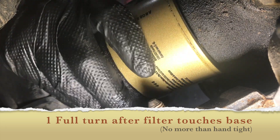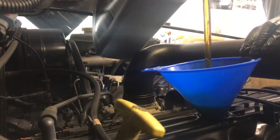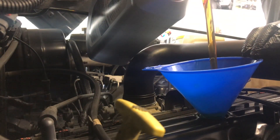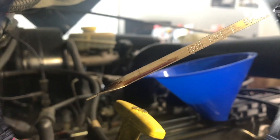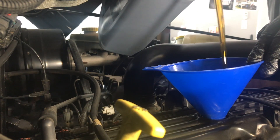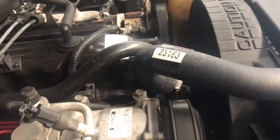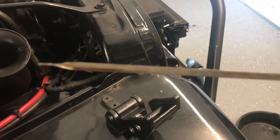Now you're ready to put your oil in — make sure you use your large mouth funnel and do not spill it. This is where you access the engine oil dipstick; it will say either add or safe. Do not overfill it. It is still below the add line, so we need to add another quart. This one takes six. You want to run the engine before checking it again to make sure it fills into the filter.